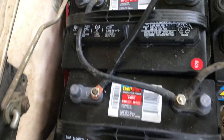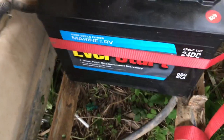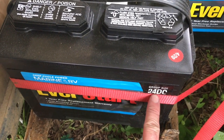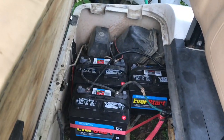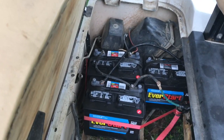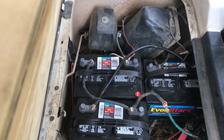Something I forgot to mention: with these batteries, these are deep cycle. You have to get deep cycle batteries — you cannot just use regular car batteries. This is 24 DC; these are deep cycle marine and RV, that's just what we had. In order for this swap to work, you have to have deep cycle batteries. You can't just use regular car batteries — you probably can put them in and they'll bolt up, but you probably can't use them like these. So get some deep cycle batteries.